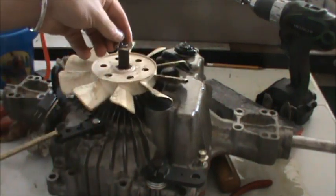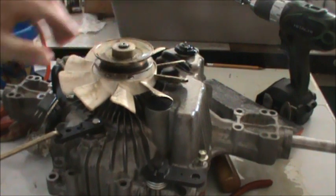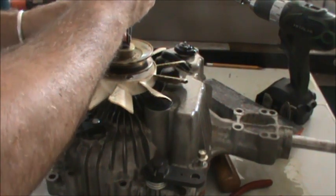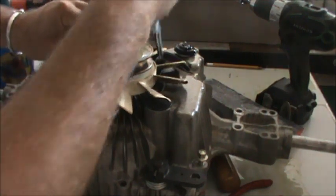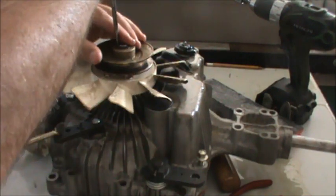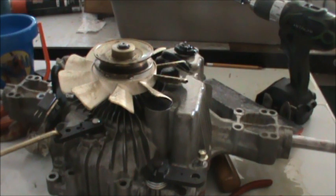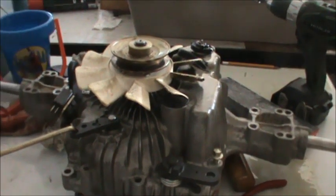The plug locks right on there — looks good. Then we put the fan on: there's a C-ring, the fan has a spline in it and one of these waffle washers, and there's a spline gear up top. Finally we attach a snap ring — I bought a new one. I'm lining up this snap ring; there we go, it locks into the groove. Be careful when you pull the old one off — I tried to stretch it out all the way and bent it out of shape, so I ended up replacing it just to make sure it would work right.